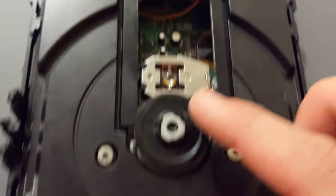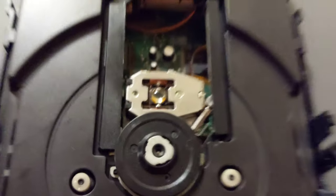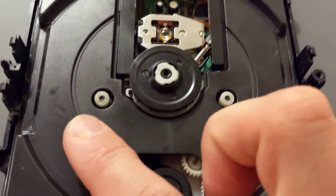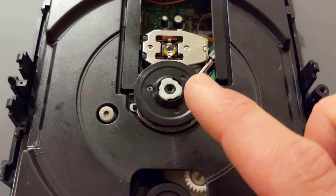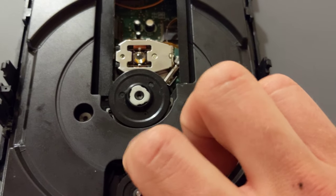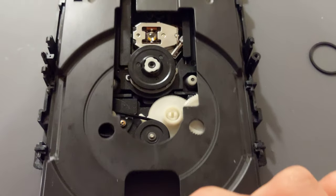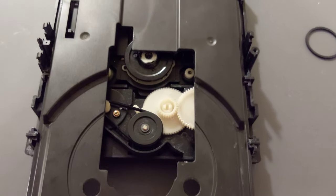To be able to pull this out, you have to lower the lens. On the grease — you can lube up those rails there just to make sure the lens goes up and down pretty easy. You have to lower the laser to get to this. To do that, you just kind of turn the gear, and pretty much it releases it, and you can pull it and see how it works.